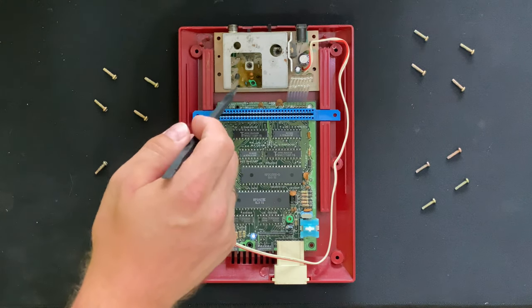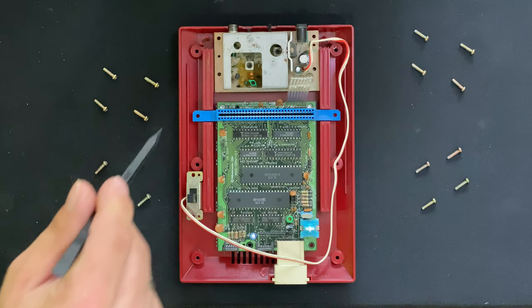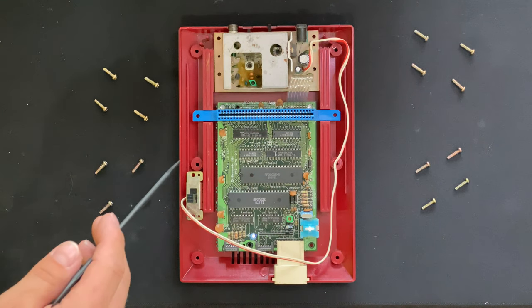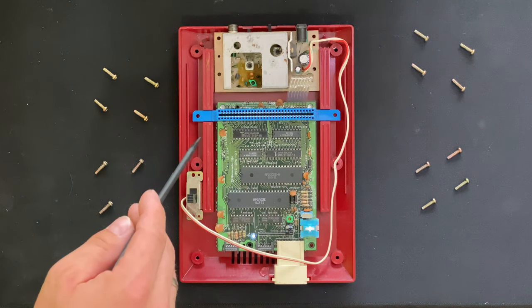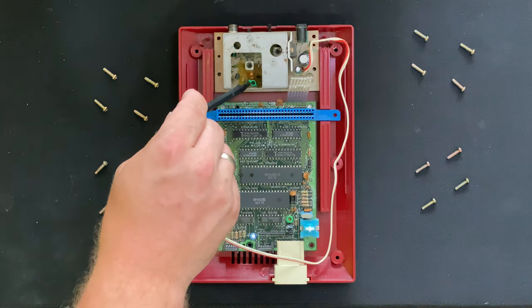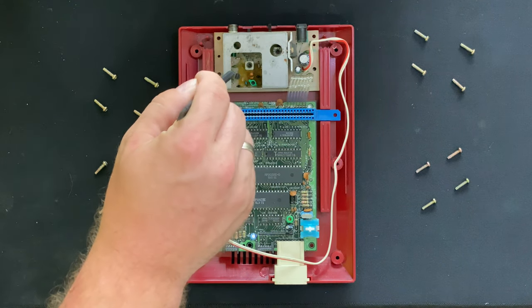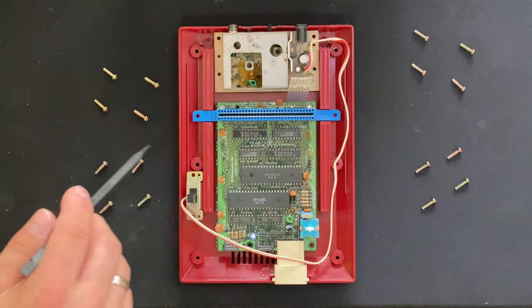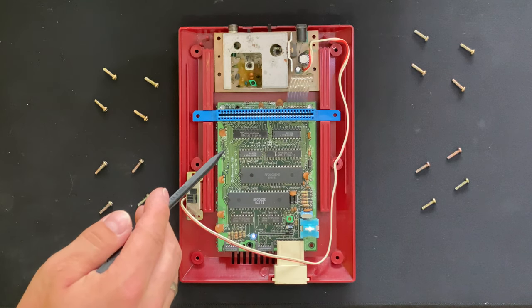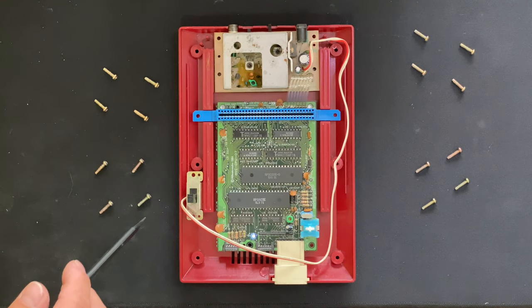On top of that there's actually a little slot that looks like it's for a flathead screwdriver. I do not recommend using that — use something ESD safe, because this unit is turned on and power is flowing through it. You will twist this clockwise and you will see the middle black piece lower; the frequency will lower, and as you continue turning it you will begin to see the image appear on the television of whatever game you have plugged in.